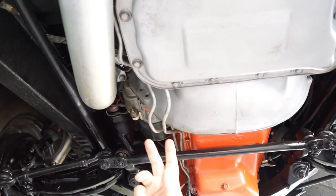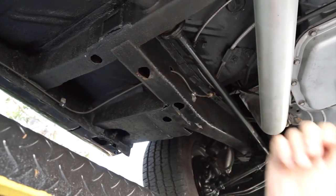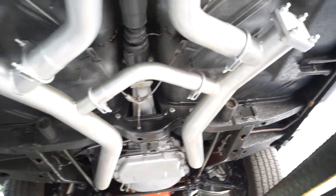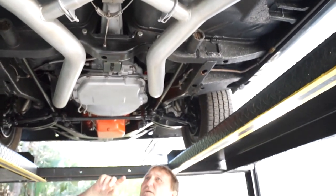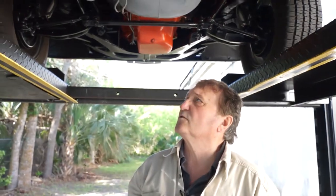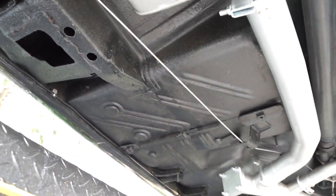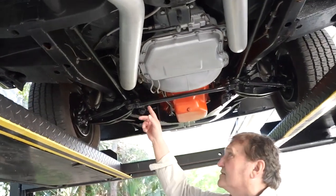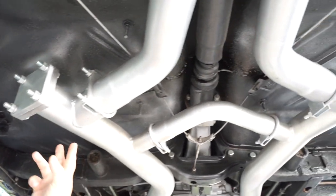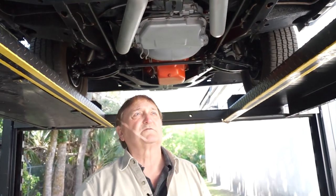The cooling lines going to the radiator are the original style. There are no marks or indentures — just one little tiny pull from someone tying it down during shipment, same on the other side. Nice solid frame. Torque boxes in the front are nice with no indentures. No leaks on the speedometer gear coming out of the transmission. The floor pans appear to be original, just like the borders and everything else. I don't see anything that doesn't show its originality, including the cast iron exhaust manifolds going into three-inch primary pipes with a crossover pipe. As they came from the factory, there were dumps that you could open up to run straight off the tuned cast iron exhaust manifolds — that's how Chrysler engineered this vehicle.